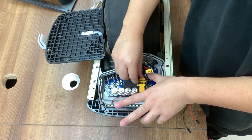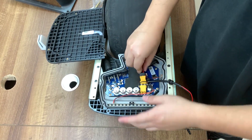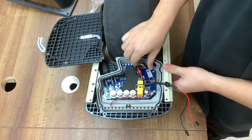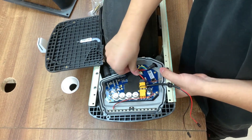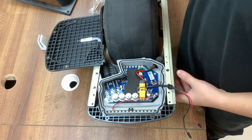Plug in this parallel powering cable and put this main power plug back into place. You do have to bend the main power cable a little bit towards the top of the PCB in case it interferes with this little white plug here.